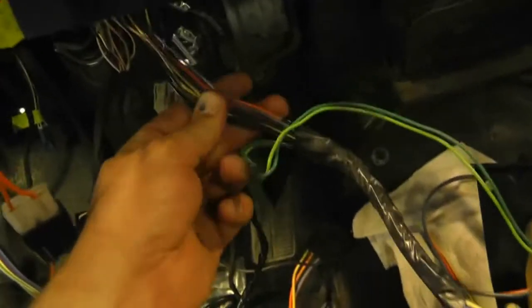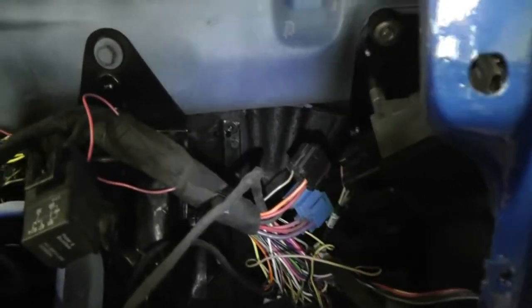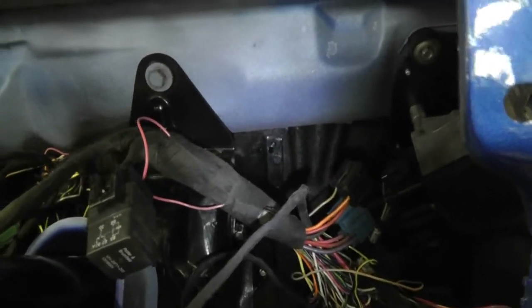I don't know what else I'm doing here — I've got most of the other stuff wrapped up. I haven't done any downstream stuff down to the heater and to where the radio should be, but I'm going to leave that for the moment because I'm going to put in a stock-style lighter in here, and I have to wire that in. This lighter actually has a light on it, so I'll have to tap off the loom somewhere upstream, probably around here somewhere. I know that this fella here is a panel light, so I'll wire it up to the same thing as that. I'll bring it back in the loom — I don't want to wrap this and then have to unwrap it and rewrap it. I've got to work out a way to strap this up in here so it's not riding on top, just for neatness and to keep the loom from moving too much. I'll figure out how to do it later.